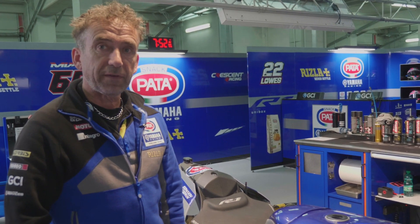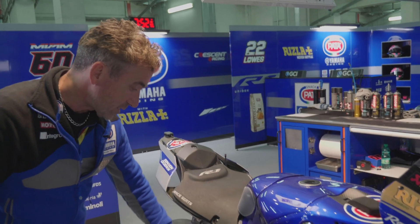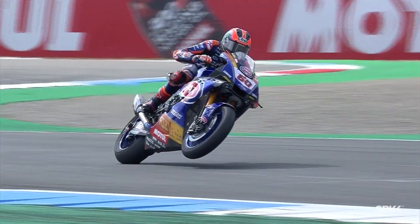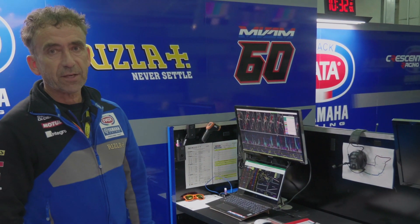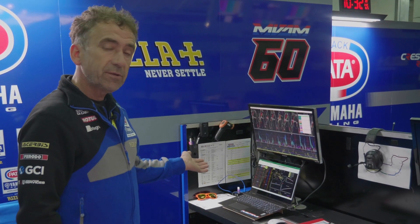Adjusting this has many effects; one of the main ones is the effect on anti-squat. Anti-squat is the resistance to the rear of the motorcycle squatting under acceleration. With all the adjustments available on the motorcycle the options are infinite, and changes can be quite time-consuming, so to understand how each area is going to affect another area of the motorcycle we use computer modelling.